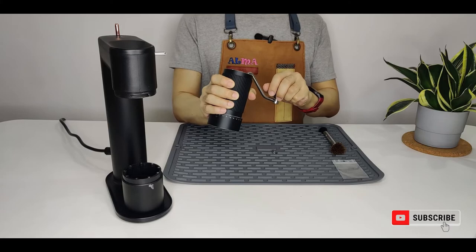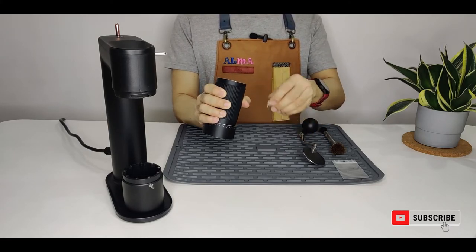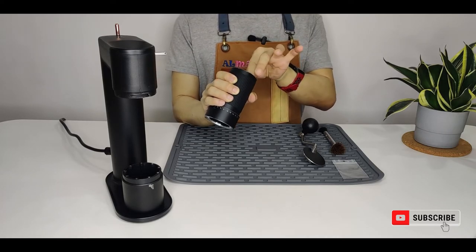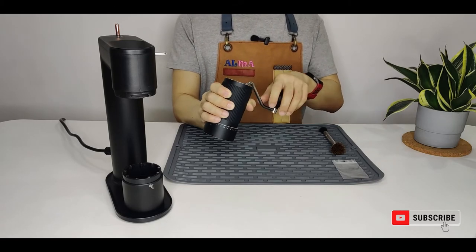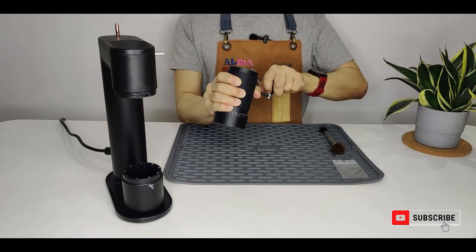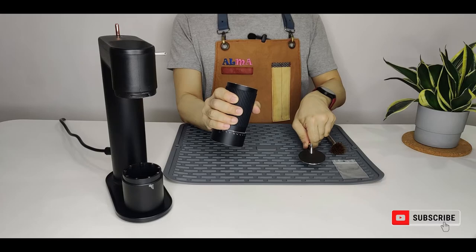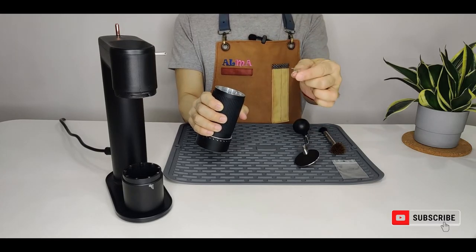After verifying the assembly, insert the axle lock tool and the crank handle. Turn clockwise until you feel resistance. Do not over tighten. Remember to remove the axle lock tool.